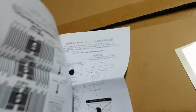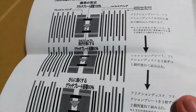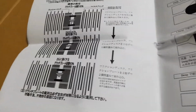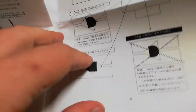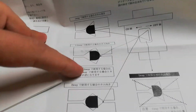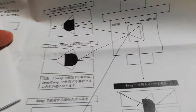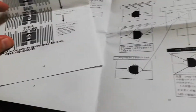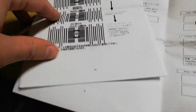differential and how to maintain it and set it up correctly, and what the clutch pack positions need to be in for what percentage of lock you want under decel, and also how to set the cam for one way, because this is capable of being a two-way diff if you set the cam the right way, but I don't want that. It's already preset at the moment in 1.5 way, so I'll probably just leave it as it is and just tell them to not worry about any of the load stuff here, because it should be set up at the max attack.